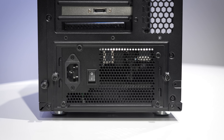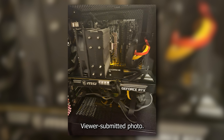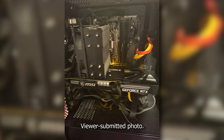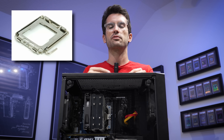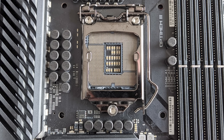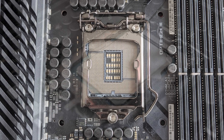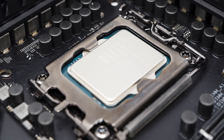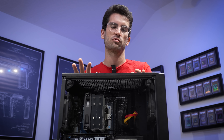There's a bit of a backstory with this rig that wasn't disclosed in the description. The owner met with me in person to drop the system off, and he told me that in the process of upgrading to a slim form-factor tower cooler from Thermalright, he removed the socket retention mechanism — the thing that holds the CPU in the socket to ensure proper contact between the pins and the pads underneath the substrate. He was under the impression he had to remove this mechanism to install the Thermalright cooler, which is not actually the case. There are a lot of very sensitive pins inside these Intel sockets that you really don't want to mess with if you don't have to.